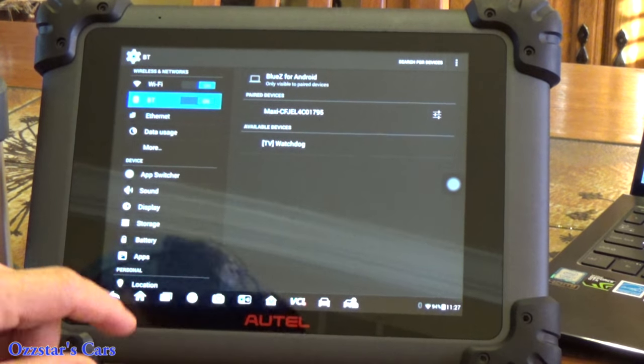On the main screen, this big green icon says Update — we've got 43 updates. Click that. When there's a big update for the software, whether you just got it or you've had it for six months, it's going to update all your different manufacturer files. There's an operating system update here, so make sure your scan tool is powered up with plenty of power — plug it in if you're low. You don't want it to cut out during an update. Once the OS updates, we'll probably need to do a system program update too.